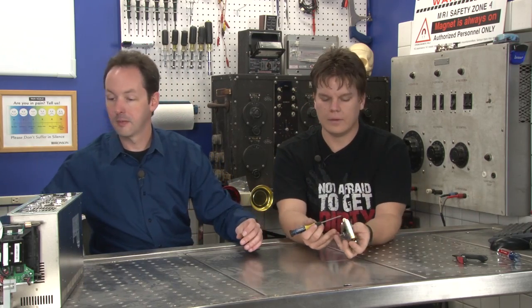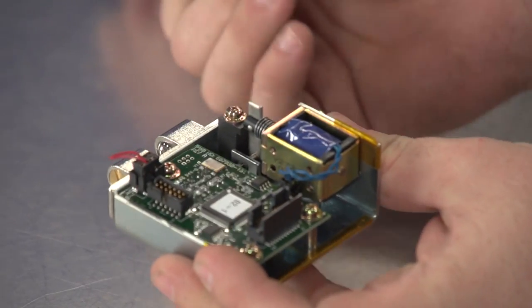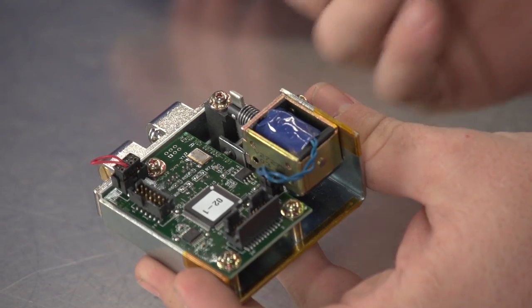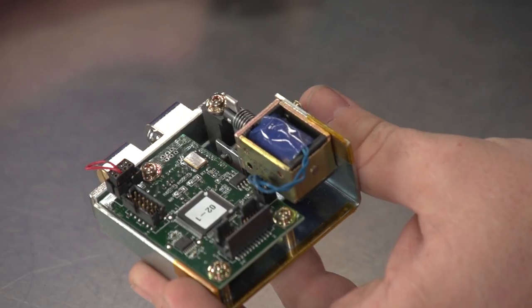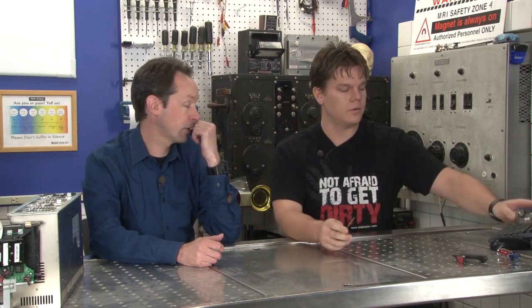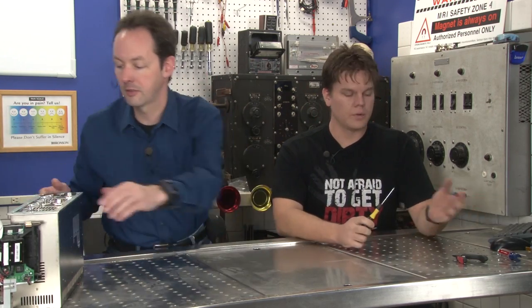That style of system with a little solenoid that retracts a little thing is pretty much how most electronic strikes work. It's the same thing. But they put a lot more engineering into them so that you can get things like X amount of kilograms or X amount of pounds of preload, which is someone pushing on the door, so that even with a lot of pressure on that little latch, it will still open. So if a dude's leaning into the door while he's trying to swipe his card, or wind pressure, like in tunnels, it'll still work. But it's a whole lot more complex engineering. So these guys can do it a whole lot simpler by putting a big detent system in it.